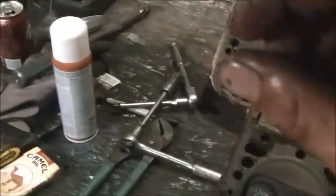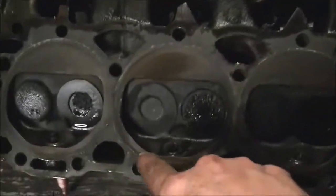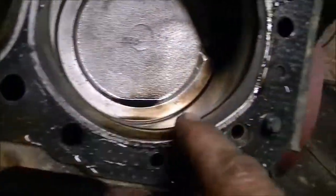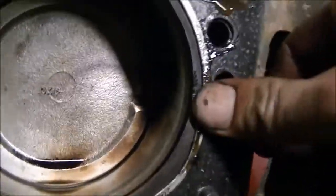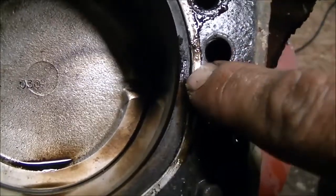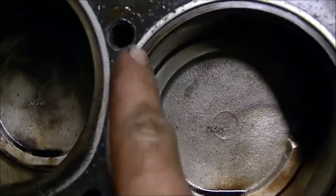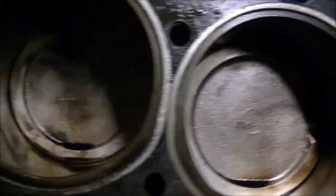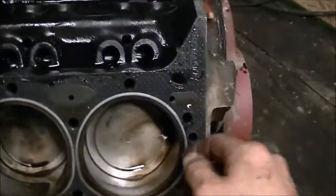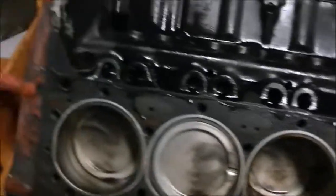It's almost right at the edge of it. You've got to think that gasket is so many thousandths thick, and then you've got all this surface area around the gasket that becomes part of the combustion chamber - it's not supposed to be like that. It's supposed to be a good, tight seal, nice and even between the gaskets. That way it's not going to blow the gasket out, and you're not losing this volume in your cylinder. That's a compression loss, a power loss, and a blown head gasket waiting to happen - it's so close to the water jacket in a couple of places.